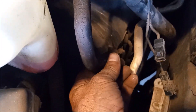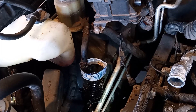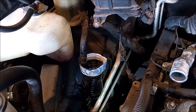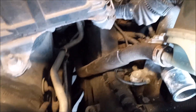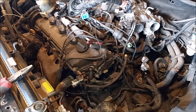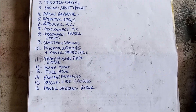And this goes to a hard line. The way to do this is disconnect this hose right here and remove the whole reservoir and put it on top of the engine. I had a little plastic bottle there ready for when I disconnected the hose. The reservoir is disconnected from its mounting point but it still remains connected to the power steering pump. It is disconnected from the frame so it can come out with the engine. We have done almost everything that can be done from the top. Let's check our list again — we're up to 16 items.